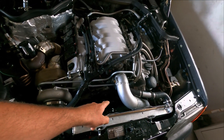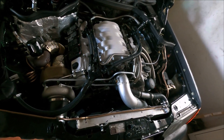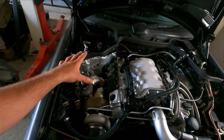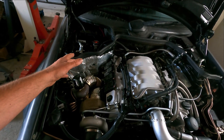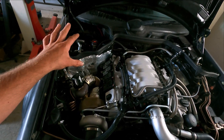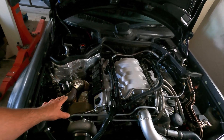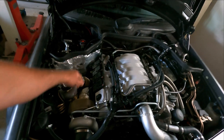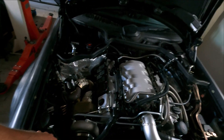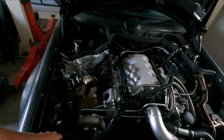Some people told me they found in the past that those vibration dampers have a piece of rubber in between and the outer ring can slide over. So the thing I'm going to do is take the downpipe off, and I'm also going to change the lambda sensor because it failed - but yesterday when I was driving home I had a lambda value, so that's weird. I don't trust that sensor anymore because it died and came back to life. That sensor is ordered. I think it happened because on the dyno we did some tuning on low boost settings, getting the fuel map, and then you get a lot of bypass over the wastegate and a lot of heat in the exhaust - not a real-life situation. So I'm going to change it just to be sure.